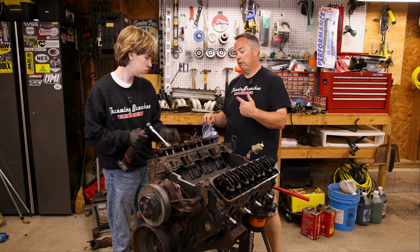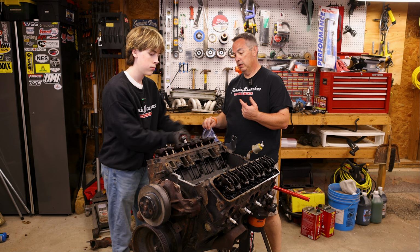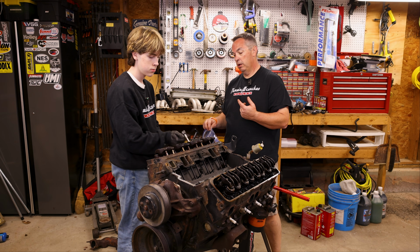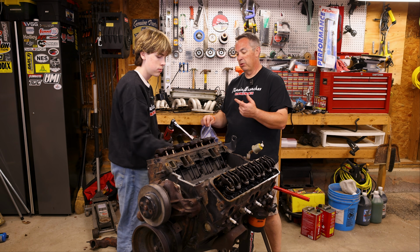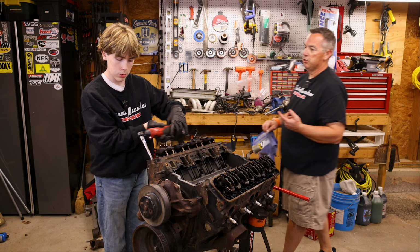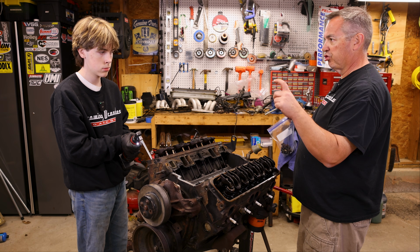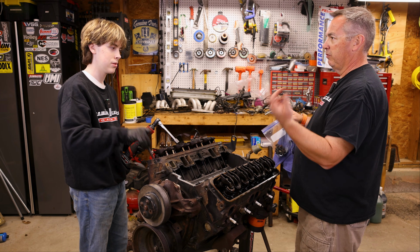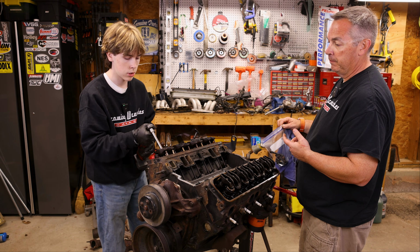Okay. So head bolts carry very specific torque and strength recommendations or specifications. And most of the time for a manufacturer bolt, they're torque to yield, which means they're single use. So you torque them until they stretch to the right amount and then you stop. That means you can't use them again. Because if you stretch them a second time, they're not going to work. Do the top too? Yep. Okay.